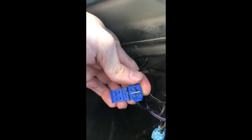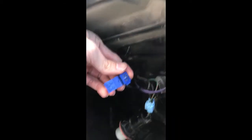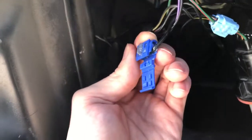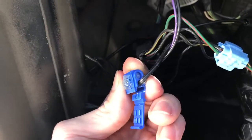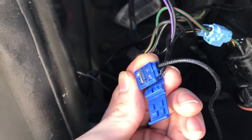You're going to slide your power wire in right there, and then now you're going to find the ground to that same LED strip and then you're going to slide it through the top. We got the power wire in right now, and so what we're going to do is slide the load resistor in through that other section in the top. Then what you're going to do is use pliers and push the metal piece down.